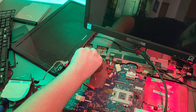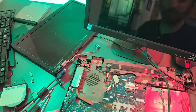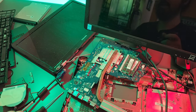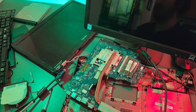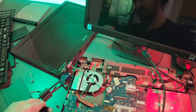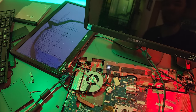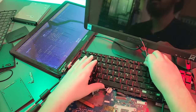That's why the fan wasn't turning — it's caked in dust. Dude, there's a spider in here. Not anymore. I've found the CMOS battery and I'm just going to take the whole thing off. This was just in the fan — gross. We're going to hope that resetting the BIOS made it so USB keyboards work, turn it on, and see what happens. We got a Toshiba screen now — heck yeah. We have reset the BIOS. The keyboard is still not working, so I'm going to plug in the OG keyboard once again. PC gaming is easy. Hey, look at that — the BIOS. We did it.